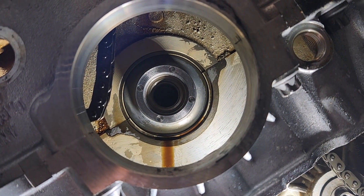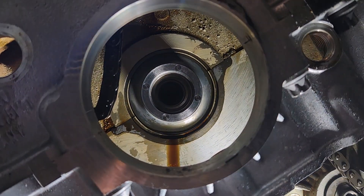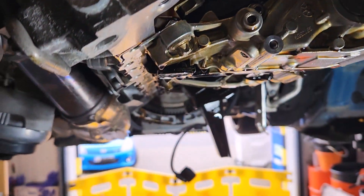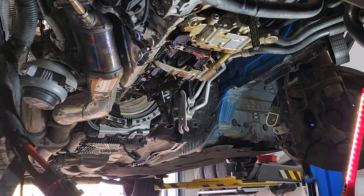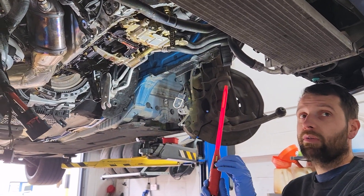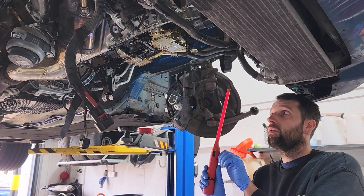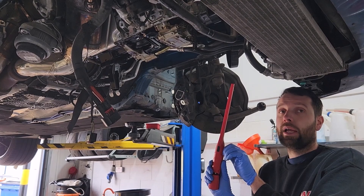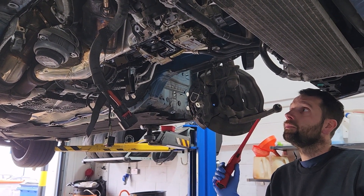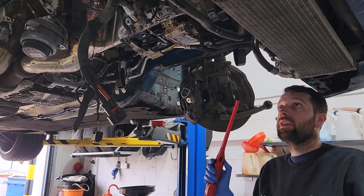You can see here the nose of the crankshaft — we've drilled it, ready to accept the new Insane 4-pin crank hub. Some people get worried about all the swarf, and there are a couple of ways of doing this. We always remove the sump so everything is covered up and cleaned with no issues. Some people have concerns about taking the sump off, but for me, all the swarf and material getting into everything — you can't guarantee 100% that nothing comes through. So it costs a bit more in gaskets, bolts, and time, but this is the best way to do it.